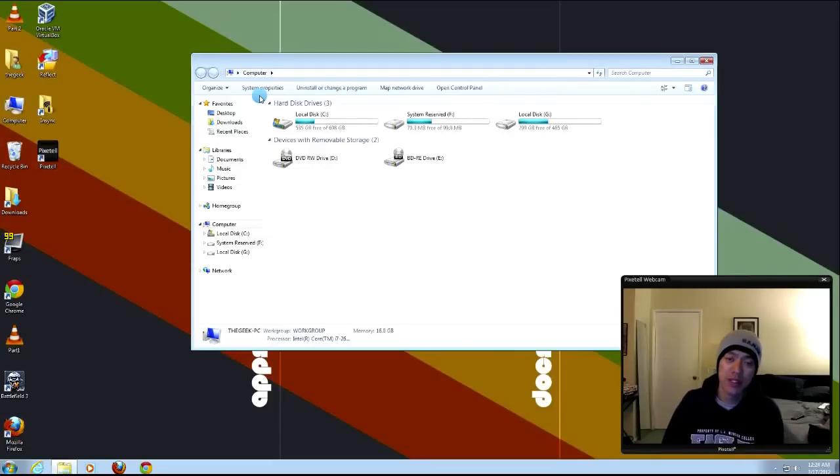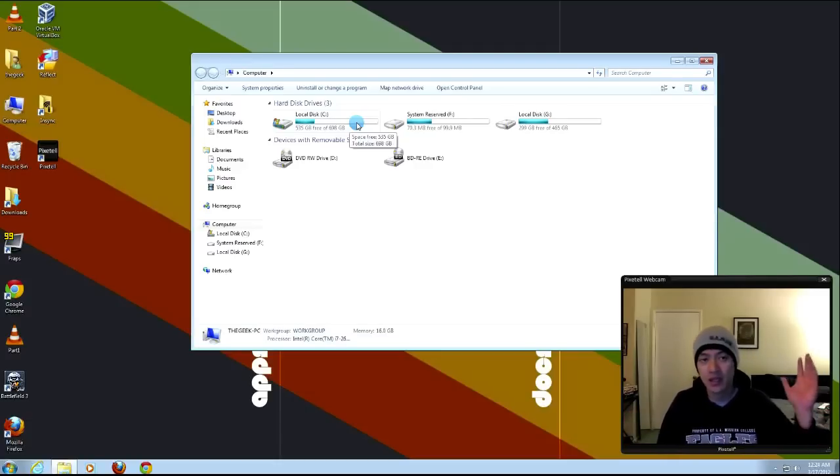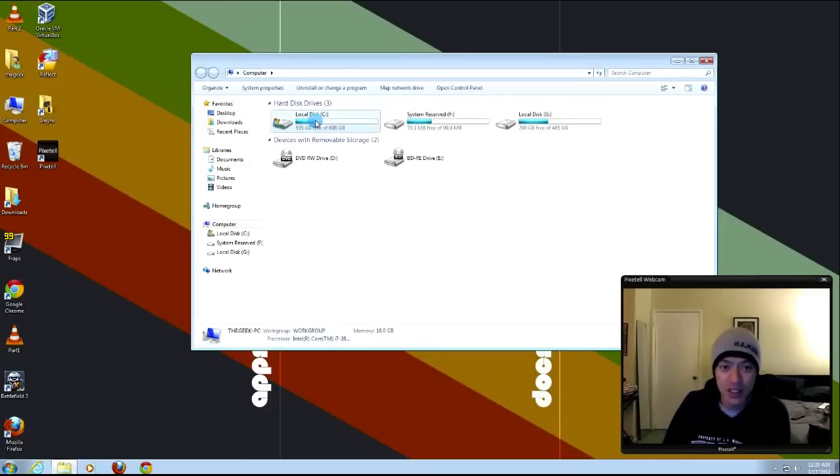The process is complete. I restarted my computer and in the BIOS, I chose the new 750 gig hard drive as my primary boot device. Remember, there are now two hard drives with Windows 7 — exact copies of each other. You would probably just remove the old hard drive. As you can see, here is my 700 gig partition and a small System Reserve. In Windows, you normally don't see the System Reserve belonging to the main OS, which is why you see two entries.